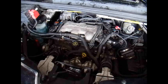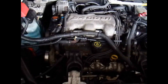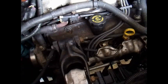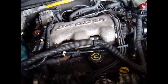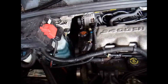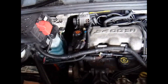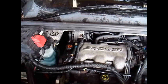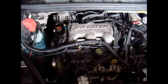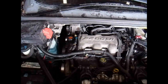Start unplugging everything. The reason I know I'm losing pressure is because after I bleed it and turn the engine off, you can put your ear down here and listen for a hissing sound. Another thing you can do is, after you let it cool down, take the vent cap off and see if you have gas escaping. These 3400s do have head gasket problems. This one's got about 150,000 miles on it.